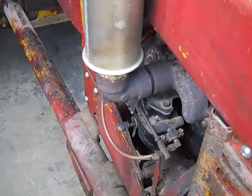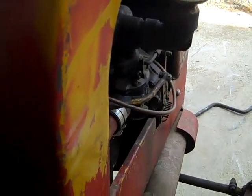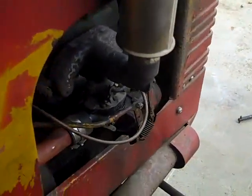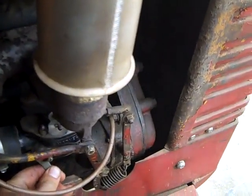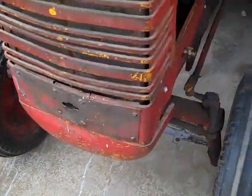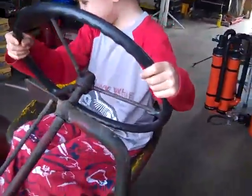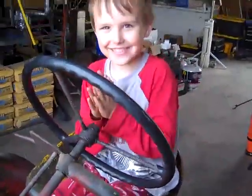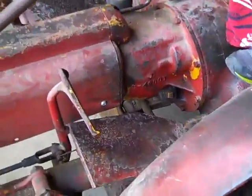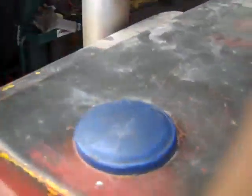Oh sweet, not smoking that bad. Let's get a little more gas. That sounds pretty darn good to me. We fixed the hand crank and we've got her running. Just took a condenser, maybe cleaning up some contacts. You ready to take it for a ride? We'll take it for a little ride here in a bit. She runs — but I'm not going to run it long because I don't have any cooling in it.